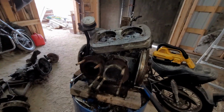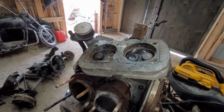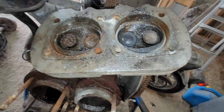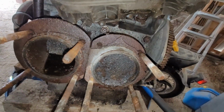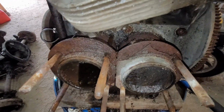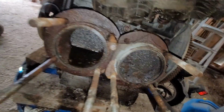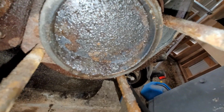Well, had to resort to bashing the shit out of the cylinder head to get it off. It's interesting. One good looking valve and the rest are rusty. She is pretty corroded. All those head studs have to be changed, definitely. That piston kind of looks like it's one piece with the rest of it.